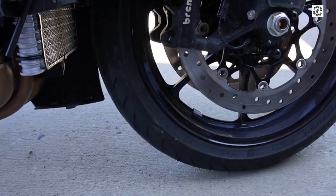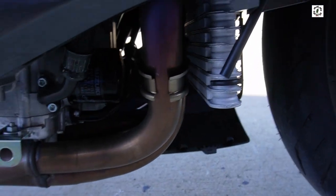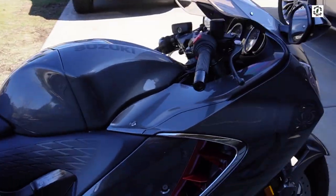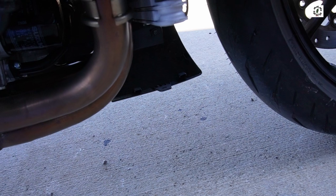The reason I've got to take this right side lower panel off is to access the oil filter here. Before I do my warm-up and drain the oil, I want to make sure I can get my wrench on here and turn it — which I can. Also looking at where the drain bolt's at, which is right here, 17mm, so I've got my socket all ready to go.